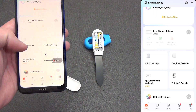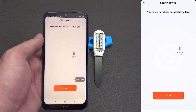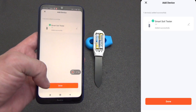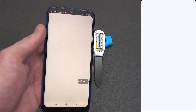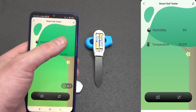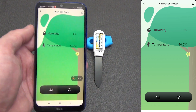I have a Zigbee version, so I first go to the menu of my Zigbee gateway and click 'Add Device' inside it. After a few seconds, the sensor is successfully found. After that, you can give it a name and assign a room in your smart home. In the main Tuya menu, unfortunately, the sensor does not show data — you need to go inside the plugin. At first, the temperature may be displayed as minus 20 degrees Celsius and the humidity as 0% — this is normal. According to the instructions, you need to wait a little while the sensor collects the first readings.